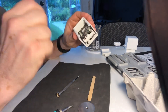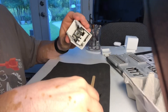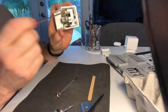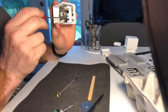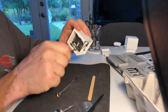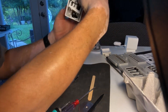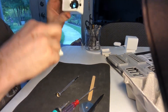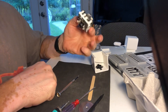There are some screws right here mounting the power board, but I don't even need to get to that just yet. We're just going to remove this one hidden screw — you see two screws but you don't want those two, you want the one that's hidden down inside. I did have to get this particular Phillips head. I can leave the screw in there — it tends to stay. Then this camera assembly lifts up and out so we've got our case and then the camera right here.